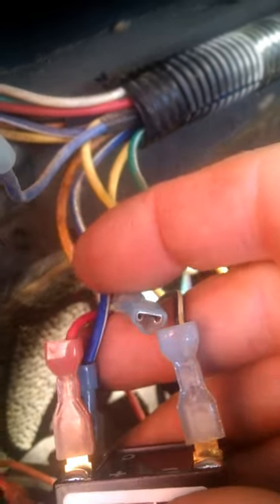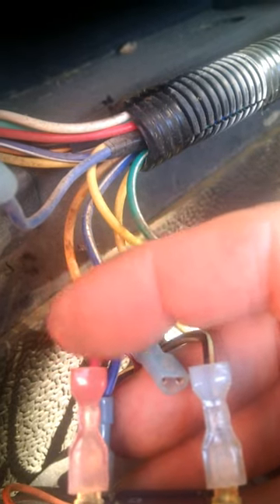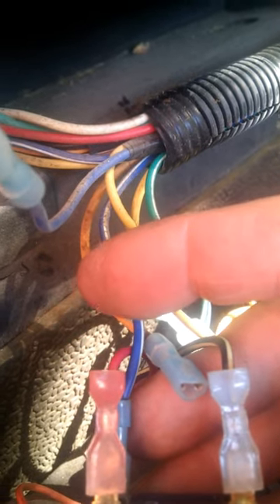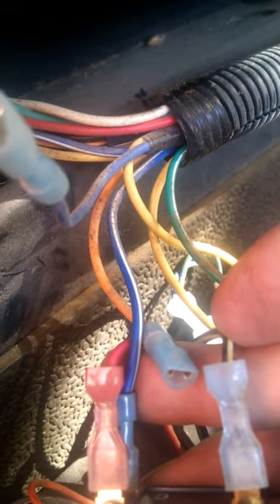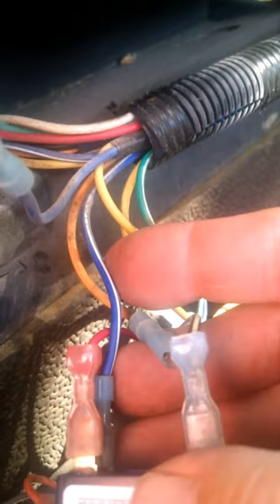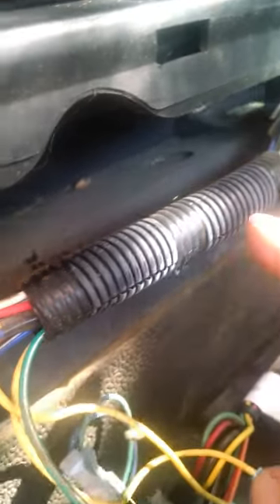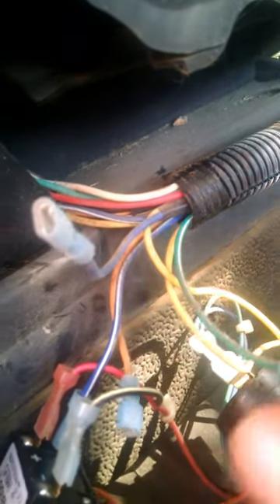There's a red wire right here, and this red wire is a positive — that's a constant 48 volts coming from the battery. This black and yellow wire is your negative. And there's another wire here, your blue wire with a white stripe that is coming through this conduit right here. It was a free wire, so it's able to hook up accessories. I've hooked all three of these to my meter.